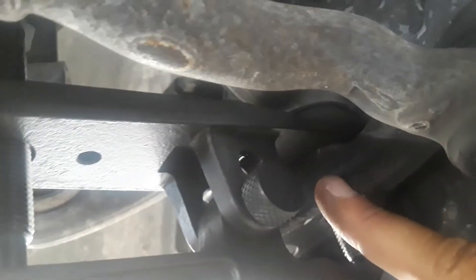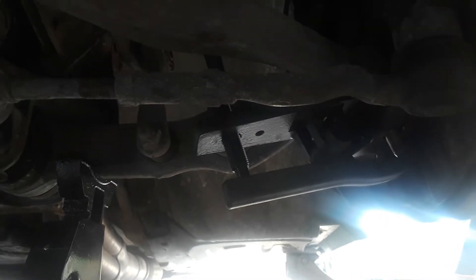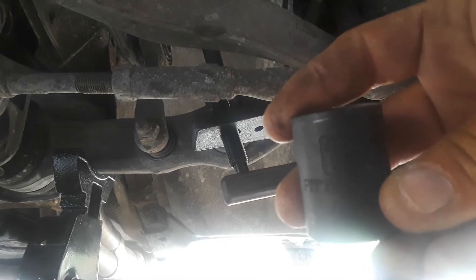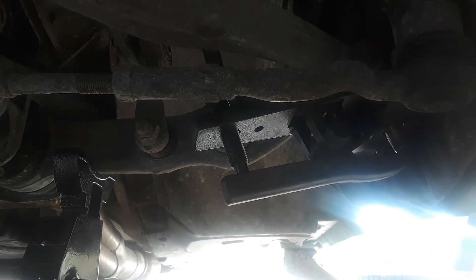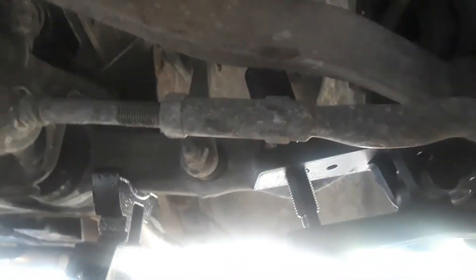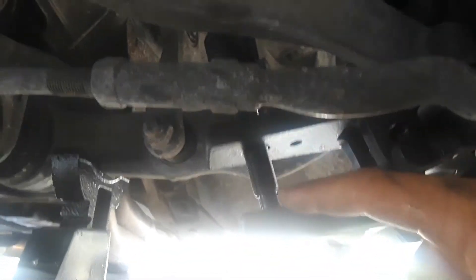The fork is going to go in between the arm and the bushing — you'll have to tap that in a little bit. Next you're going to take your 19 millimeter socket with the ratchet. I'm not sure if I can get the impact in there, but we'll use a ratchet on top here. You just turn this, it'll come down and this will come up and pop the ball joint stud loose.